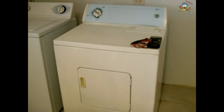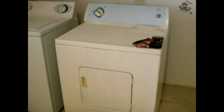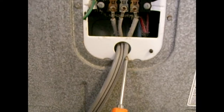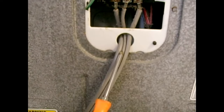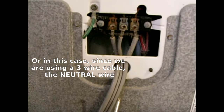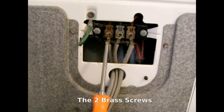The first thing you're going to do is check to make sure there is 240 volts being supplied to the dryer. I'll now show you how to perform that test, which is located on the rear panel. Looking at the power cord, each end is a 120-volt leg — this is a hot wire coming in at 120, this other wire is another hot one at 120, and the thin one in the middle is your ground. Set your meter for a 250-volt or 1000-volt AC range.